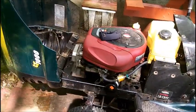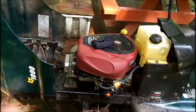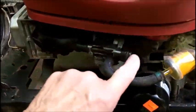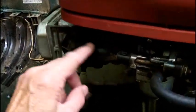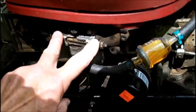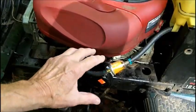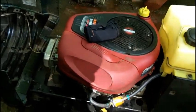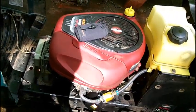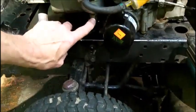Several people have agreed that's the correct carburetor, and I've been watching videos — both ones my viewers supplied and ones I looked up. There's a long bolt here so you leave this part on and remove this plastic piece, and basically you've got just the middle part which is the carb itself. The problem is going to be unhooking the linkage — they show you you've got to turn the carb a certain way to get it off. Getting them off is not the problem; trying to reverse the procedure and get them back on is.